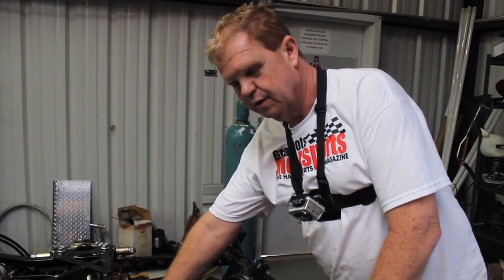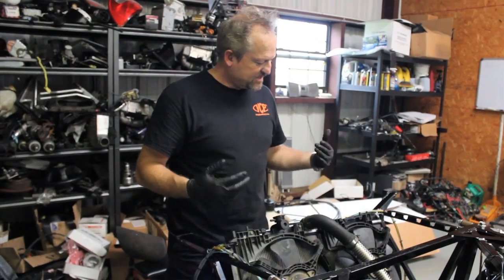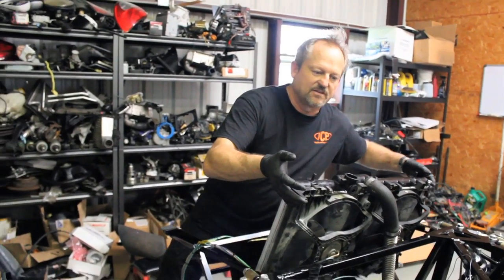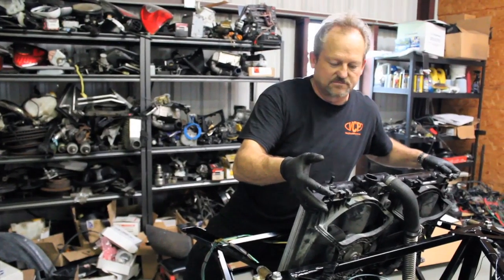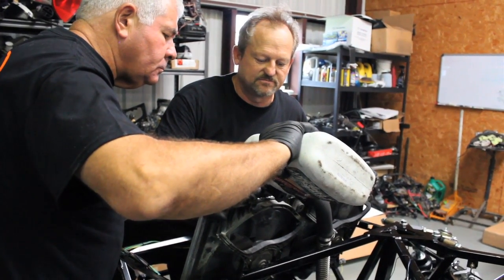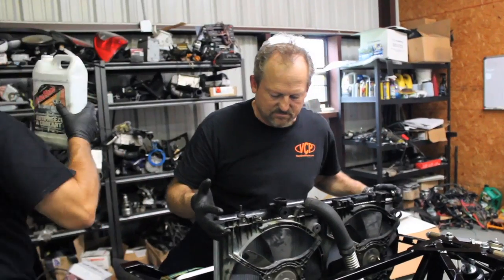We didn't bolt this in yet because there's a problem with cooling air trapped right here at this high point of the car. With the radiator laying down like this, you can trap an air pocket here and also in the lower hose. So what I do is, before I permanently mount the radiator, I just lift it up like this. And if you could hear this, you can hear the water running, filling up all the hoses. So we need more water - let's go ahead and top it off before we've got it held up. And that's filled up.